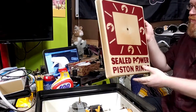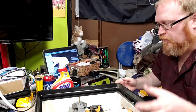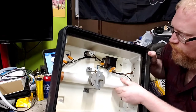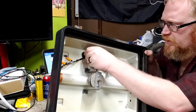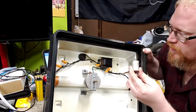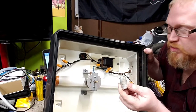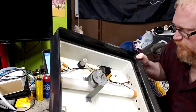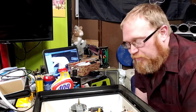It's got just the right level of yellowing plastic patina — that's got a pretty good look. Now I can get a look at the inside. Pretty simple. It's quite the chunky fluorescent tube in here. There's a transformer, and then this little thing — I don't know the proper term, but I know it's kind of like an igniter, a starter. I remember playing with these a little bit when I was a kid: once the light was on, you could take this out — you don't need it to keep the light running, but you do need it to get the light going.